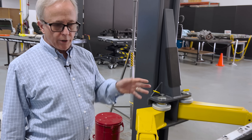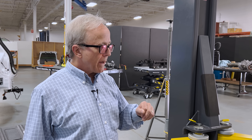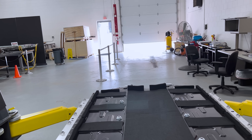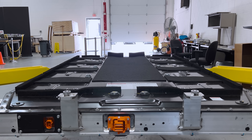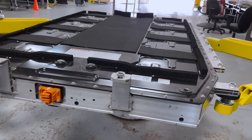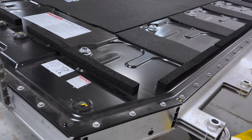There are quite a few bolts that make this a very rigid assembly when installed. The points about this pack were previously covered in the context of the IONIQ 5 or EV6, which had very similar packs. This pack has a single cooling system underneath it — a single cold plate with a single inlet and a single outlet. That's both brilliant and a slight cause for concern, as it makes it very easy to plumb but exposes the aluminum cold plate to the atmosphere.